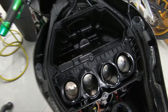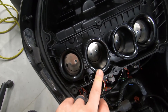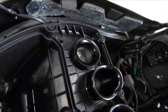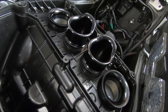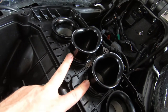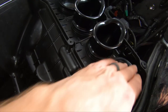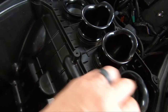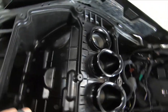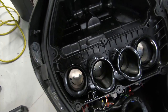Here it all is — this is the air box with all the foam taken out of it. Here are the new Graves stacks. You can see vividly how much shorter these stacks really are compared to the OEM ones. The two in the middle are about the same height as the OEMs — they're basically identical, just made out of billet material and anodized black. Really nice quality, very nice material. I feel like Graves really did a good job on these — the finish is nice and smooth, all the machining looks nice and clean. It's a very good product.